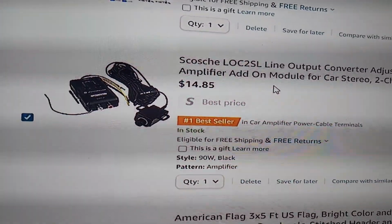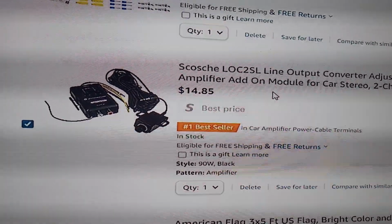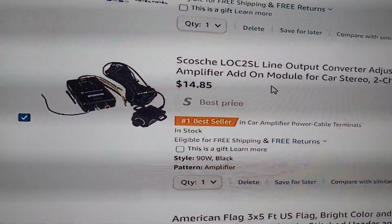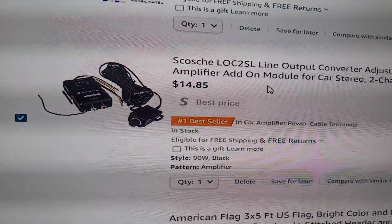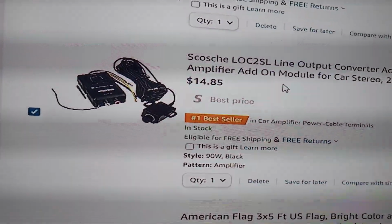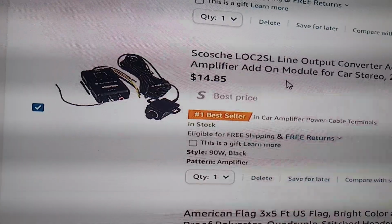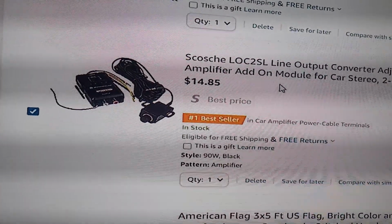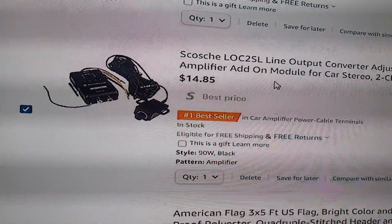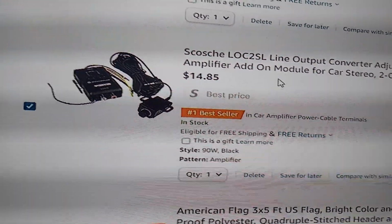For like a good 5, almost 10 years, Chevy got rid of the accessory wire. It's like, what are you doing? And then they want you to buy this other aftermarket stuff. So the other thing I like about it is it just has a simple headphone interface bass knob, which is exactly what you need. And then when doing the inputs on it, basically I just tie the 2 inputs together, the 2 positives together, 2 negatives together, and then you just tap off of one source.